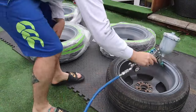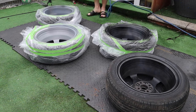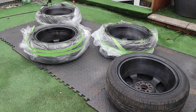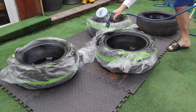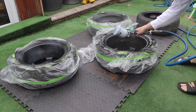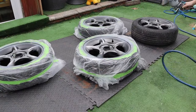Now that the wheels are all clean I can start laying down some colour. I'm using a compressor and a spray gun, however if you don't have that you can go to any paint manufacturer and get any colour made up in spray cans — from previous experience I'd recommend one can per wheel if you're doing the barrels and the faces. The first coat you want to lay down is quite a light coat; when laying down your base colour you really do not want to go heavy because getting runs out of base is an absolute nightmare. It's much easier to get a run out of your lacquer, so on your second coat you can go that little bit heavier.